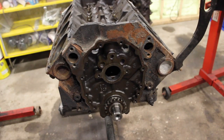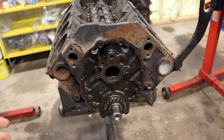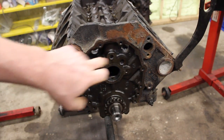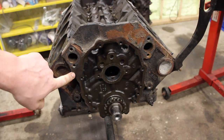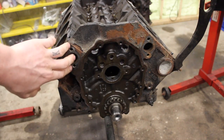This middle block is a late model Vortec 880 block, really late in the series. As you can see — and I showed this in my other video — the timing cover is not drilled for the extra bolt holes and there's no hole for the water pump bypass. So on these Vortecs they didn't use the bypass.